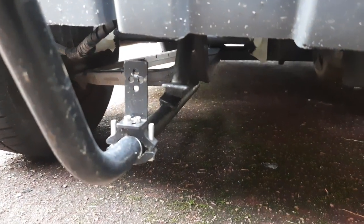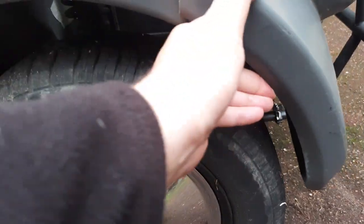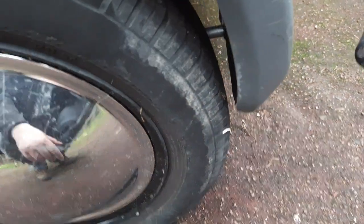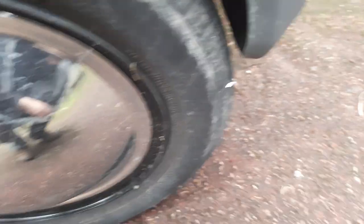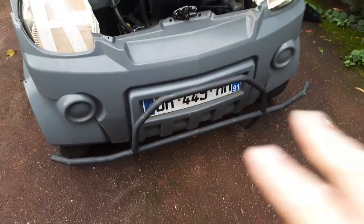I've got a lot to think about because I don't want the front end to suddenly flop about everywhere. If you look at some of my earlier videos, one of the problems I had was that even if it's fixed with these three holes, it can still flop backwards. When you turn around a corner, the front wheel rubs into the panel. I really need to move the brackets quite far forward - you can see them through the gap there - to avoid having the tires chafing on the front panel.